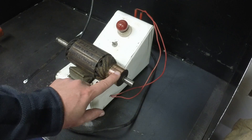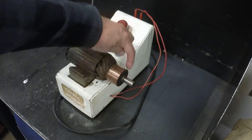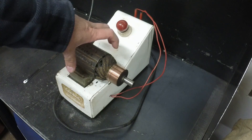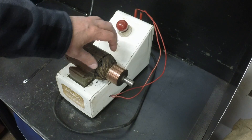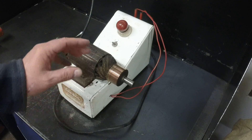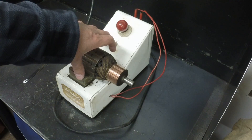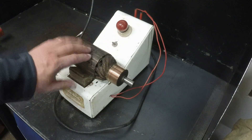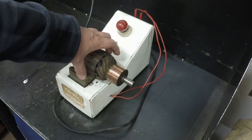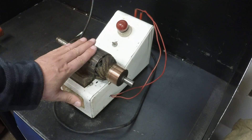They had two copper rings - if you cut this in half they're solid all the way around. Two brushes ran side-by-side; that was your field winding, and your armature was out on the housing of the alternator. So the brushes on an alternator carry low voltage, low current with the field windings. On the alternator the heavy current was carried through the windings in the housing. Because of the way they were designed with the field spinning and the armature static, it developed AC current - that's why they're called alternators. So they put diodes in them to change the alternating current to direct current.